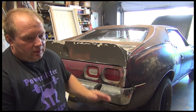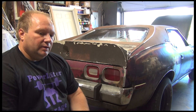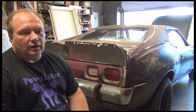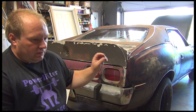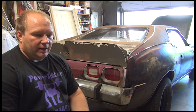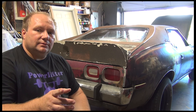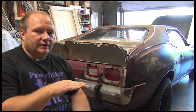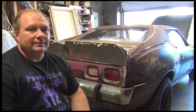The turn signal switch is basically gone — I think it all has to do with the steering column and the ignition. I'll go through and check all the lights. I know one of the reverse lights doesn't work; I'm assuming it's a bulb but I'll go down through that avenue. The front marker lights and the front turn signals are missing the lenses and don't even have bulbs in them. Not knocking anyone's work, but somebody inspected it and none of this stuff was there — just do your due diligence.